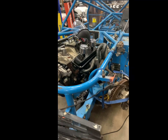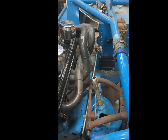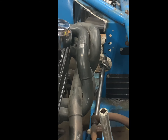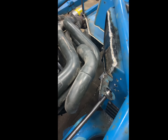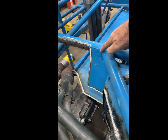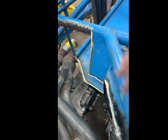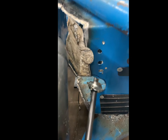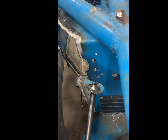Welcome back YouTube. As you can see we've got a little work done on the steering — we have it dummied in and kind of mocked up. We're going to use a firewall bearing as I mentioned, but we obviously have some work to do here on the firewall. We're going to trim it straight, come across and go straight across, eliminate this piece, then trim that down to make it look a lot neater. The new firewall piece will take all the way over here, eliminating as many holes as we can to give us fresh metal to mount the firewall bearing to.